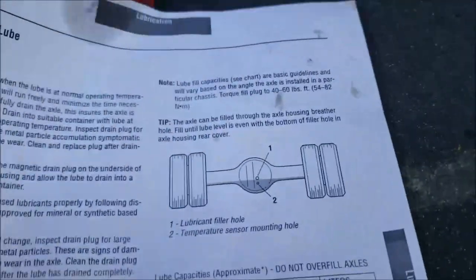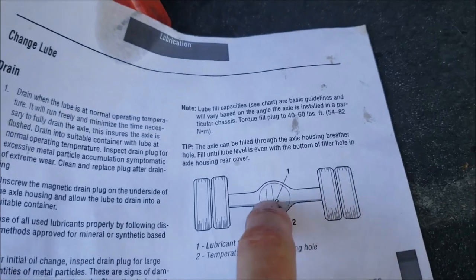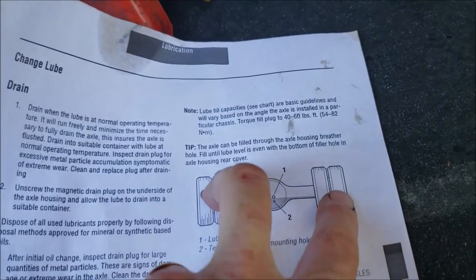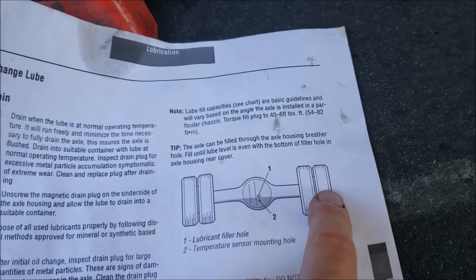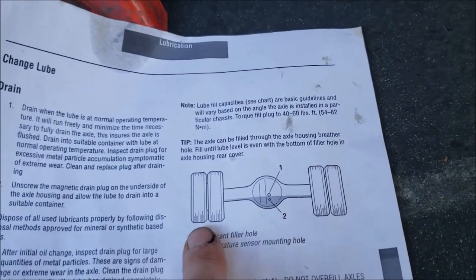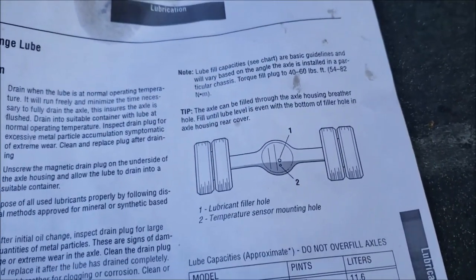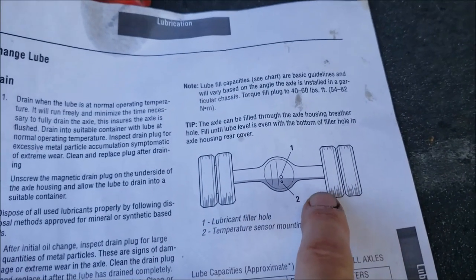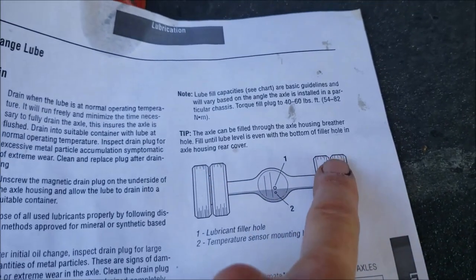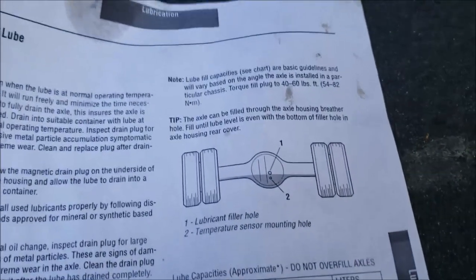See how the differential is — you've got separate hubs out here and they kind of dish down. You put new bearings in them, the only way you get oil to them is you've got to tilt the axle up so the oil will drain into the hub. You've got to do the same on the other side too. I illustrated this in the brake job I did about five years ago on my W24. You've got to raise up both wheels about eight inches to get that oil to roll out into the hub. Something to keep in mind.